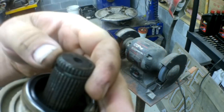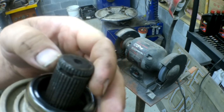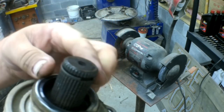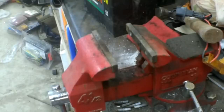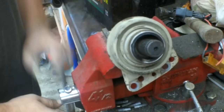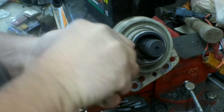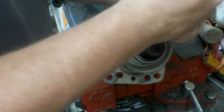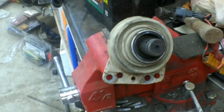This little clip right here is what retains the axle shaft onto this shaft. That was just seized right up and this whole splined area was just full of gunk — that's all you're breaking loose, just that little clip, just like on a regular axle. I put it in a vise and I'm using a pick just to clean out each one of the grooves in the shaft because I couldn't get all the way in beyond that seal with a wire wheel.